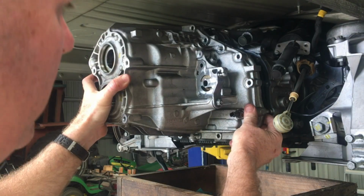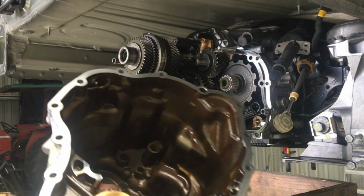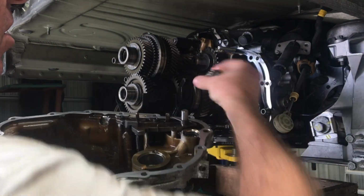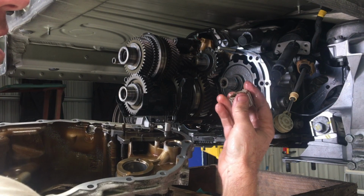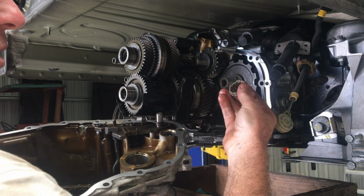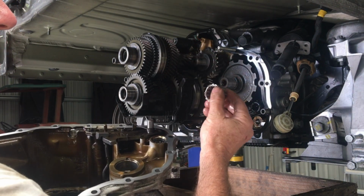Okay, I can see that's just sitting on the pinion shaft there. There it is. And it might be stuck in that little thing in there. The clips on this, and it's really important to notice the orientation of this: the little clips on the end go in the rear casing. They're designed to clip in the back, but oftentimes, as I've talked about, they don't. If you are installing this and it's not going to clip into the rear casing, I'm going to put it on the pinion shaft for installation.